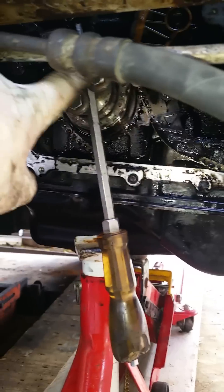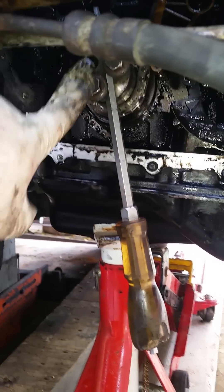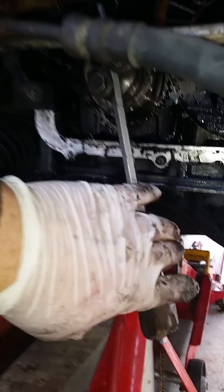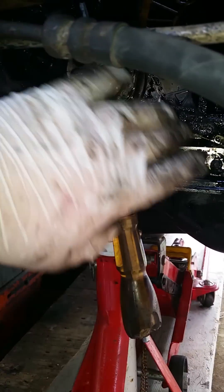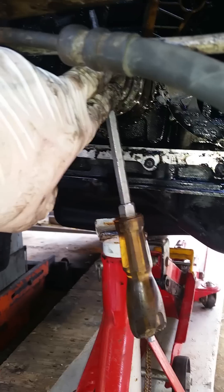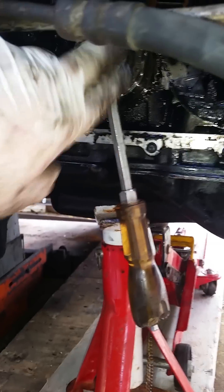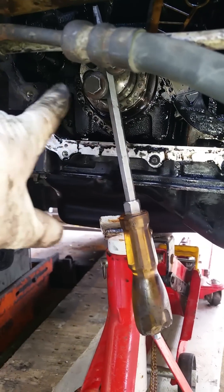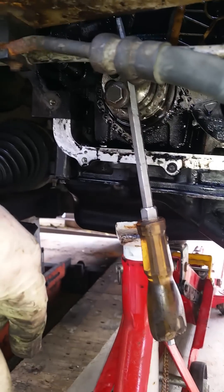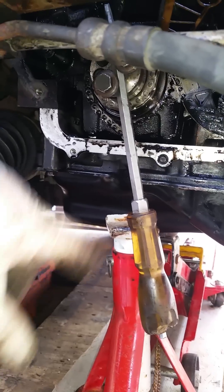What I've done is I've put two bolts back into the crankcase wheel, into the crank. I've put a fixed screwdriver on it and I'm basically going to turn and rotate the engine until the arrows are pointing upwards and I can lock the two 6mm drill bits in. There's actually a hole in the side of the van where you're able to inspect and make sure that both the cams are lined up where you need them to be.